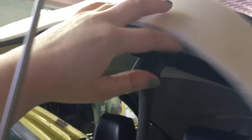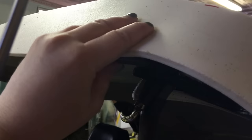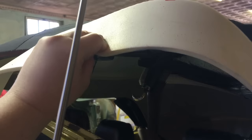We're putting a foam piece on this front header bow. Looking at the liner you can see through things like the hole notched out for screwing the bow to the frame — little things we don't want to show through the vinyl top. If you order a kit it may come with foam; ours didn't, so we got some from a fabric or upholstery store. We'll glue it down and trim it to size.